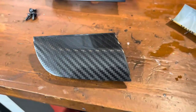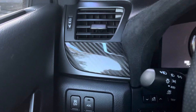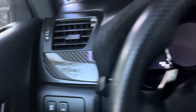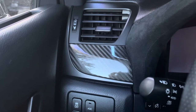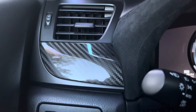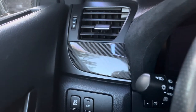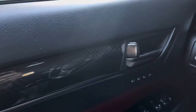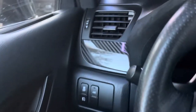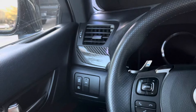I'm pretty happy with it. Back on the car — some texture to it, not that bad. It's not like the mirror finish that the OEM is, but you could get that mirror finish with more coats. I don't think three is enough because you can see right there in the center where I kind of burned through. I would probably go with five coats next time, depending on how bad the other panel gets. But honestly, I'm calling this one a success — looks way better.